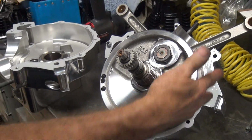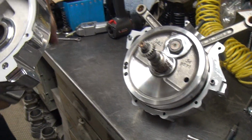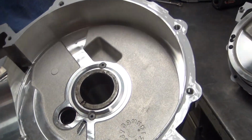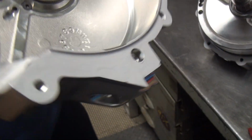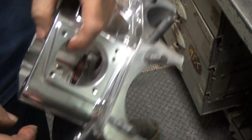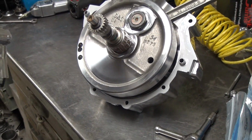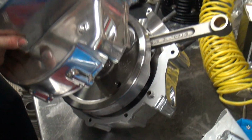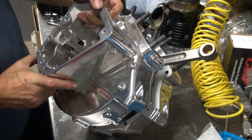Now you notice how it's air drying right now. So you're letting it tack up. It's getting tacky right now. Now, if it's done correctly, there should be a nice smear of sealant poking out when I tighten the case up. If not, your coat might have been too thin. Now, you got this stupid gear on there in the way which scrapes up our case when we slam it in. So you want to try to refrain from scratching the surface when you do that.